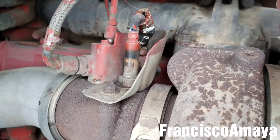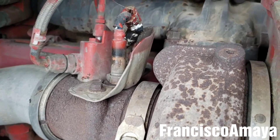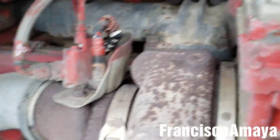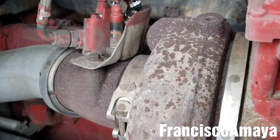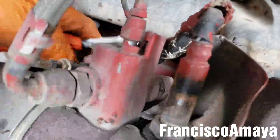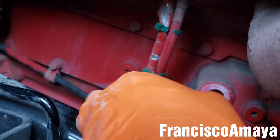To replace this sensor is both hard and easy. It's easy because it's located right here, but it's hard because it's not as easy as it looks. The first thing we want to do is cut the zip ties. You're gonna look for zip ties all over the cable. We'll cut them out and get the cable completely free.